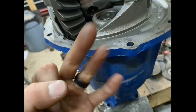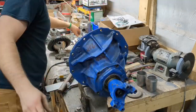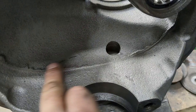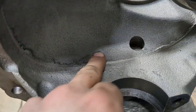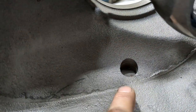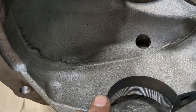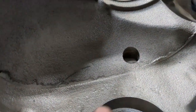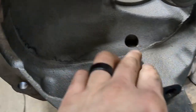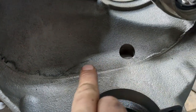Let's take it apart for the third time. You can see our line where our ring gear bolts are touching the case, and there actually is a really big casting ridge right here too. So I'm going to start in this area with a flap wheel as well. You can see the thickness of the threads here for the fill port — tons of material in here. We're not taking a lot off, but we were pretty much at zero backlash during that last test fit, so the ring gear is going to have to come this way further. Realistically we're only going to take off about 50 or 60 thousandths of an inch.